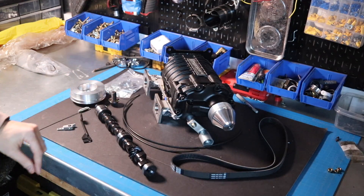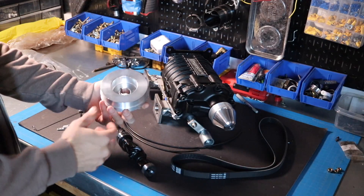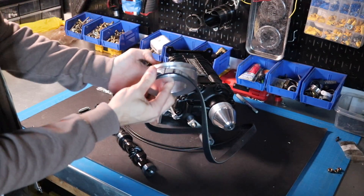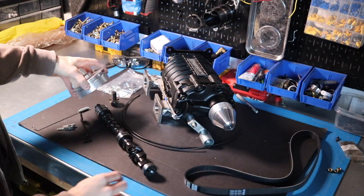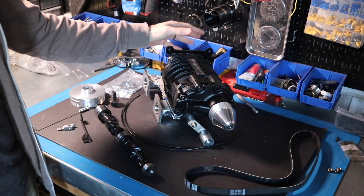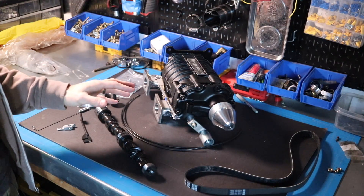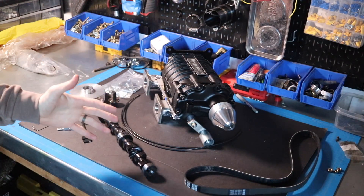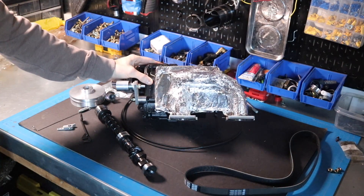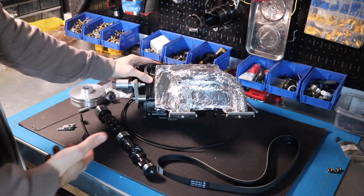It does take a little bit of work to get them working just the way we want to. These are modified to have a standard pulley on the side here. This pulley then connects to the actual harmonic balancer — the kit comes with a full belt kit pulley set. A new belt gets placed on this pulley, you have the standard spot for your V-belt which is for your alternator, so you've got two belts running off that pulley. You might notice there is no intake system, and that is because I'm going to be doing a fuel-injected setup on the supercharger. You can see the intake manifold on the bottom, fully bespoke, with two inlets that run to the two intake ports on your Mini. There's also a belt tensioner which will tension the belt and allow the pulley to manipulate the supercharger and increase boost.